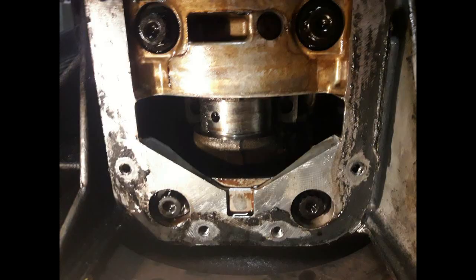And I still didn't have lift. The entire head was new and I still didn't have lift. I drove it for a little while and then spun a bearing. The craziest part was when we took it apart, there was rust all over the crank — rust in between the bearings and crankshaft journals, hit marks everywhere. I was actually amazed it ran that long.